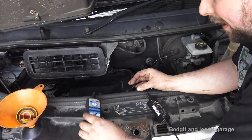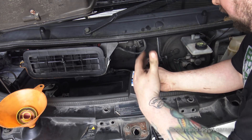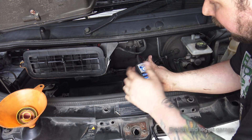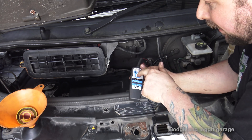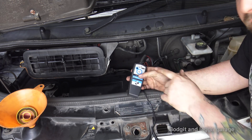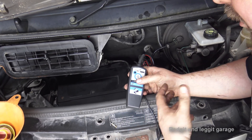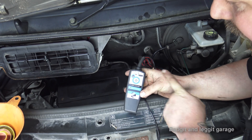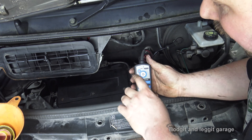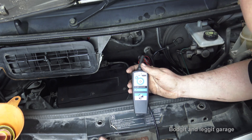The good thing is you can hear a beep when you plug in. If you plug into the EGR valve and immediately get a beep, you know the EGR valve is done. Once I clip it in properly — no beep — so we know there's nothing internally wrong with it. Press the button once and it opens or closes depending on position; press again and it does the opposite. Hold the button down for three seconds and it goes through its cleaning cycle — opening and closing repeatedly. After 90 seconds it will show a red light or green light, or a beep. Green light is good; beep or red light is bad.